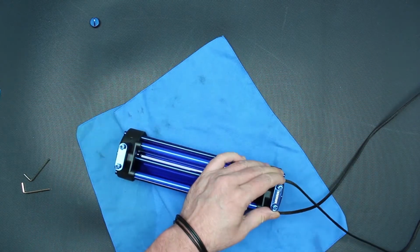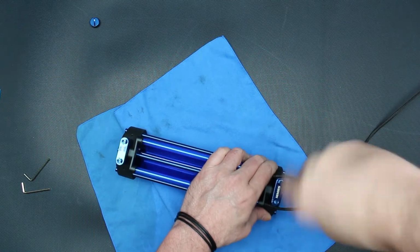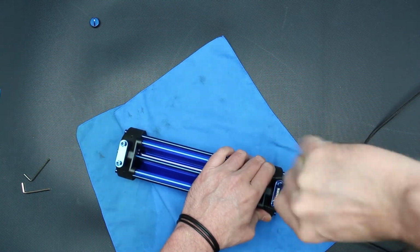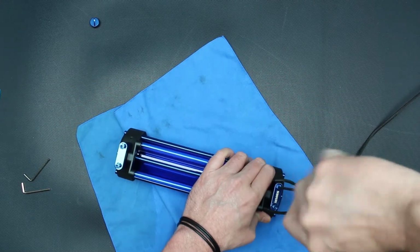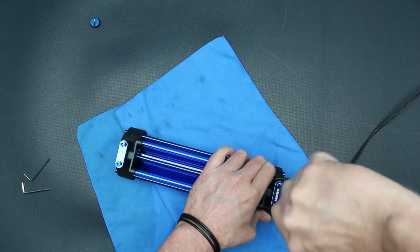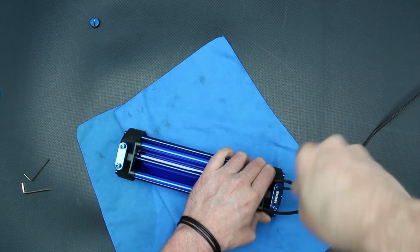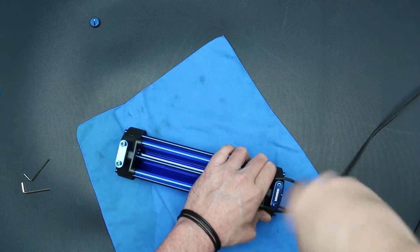Alright, once the lights are started, basically just going to tighten the screws down. Again, do this once outside the case before you mount it inside your case. It just makes the threads a little easier to work when you're elbow deep in your case later on. You're trying to line everything up and hold it in place and all that. It's a little easier on you if the threads have already sort of been pre-conditioned like this.